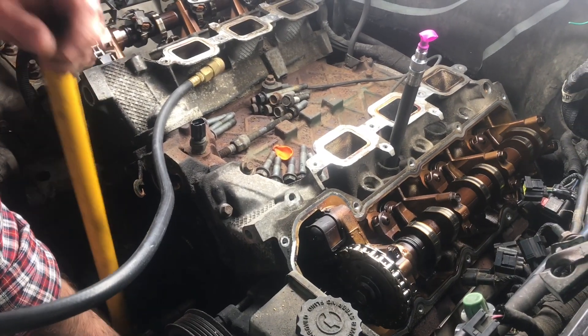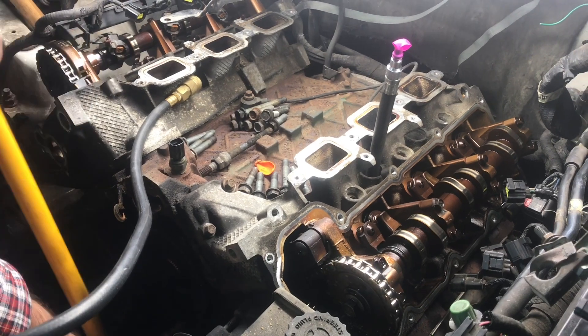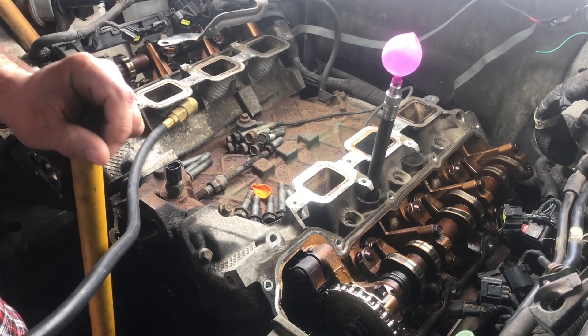You can see if the piston is going down. If you know the piston's coming up and the balloon's not inflated, you know that's the exhaust stroke — because the balloon wouldn't puff up since all the air is going out the exhaust. Now on the compression stroke, it's going to inflate.